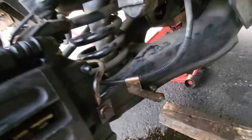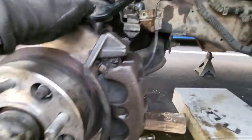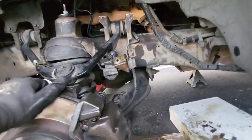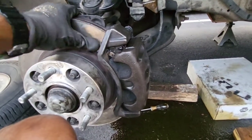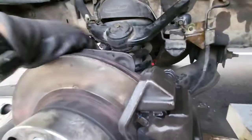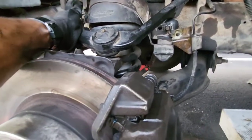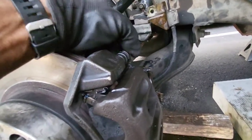I did get the brakes done — it was a pain in the ass. Some of the pistons are starting to crumble away. We need to get a proper compressor tool for the next side because it's going to probably cause damage trying to do it the same way. Be careful how you compress your piston because if it's old and worn out it might start chipping away.